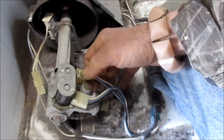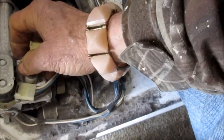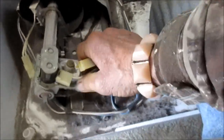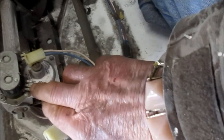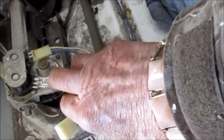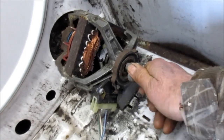So it's probably going to be one of these valve coils. My guess — we're looking for continuity on this: continuity between these two, and then continuity on these between the side ones and middle ones. The motor seems good; there's no slop in the armature back and forth.